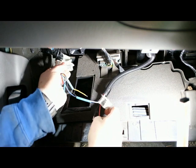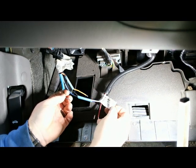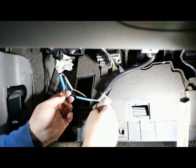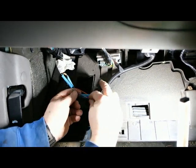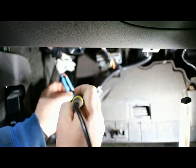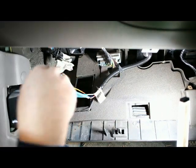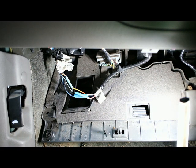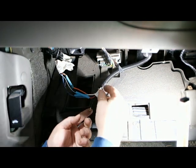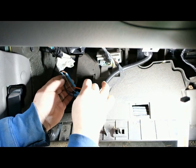And then we've got light blue is our turn signal, or is our brake light signal, and that will be red on this one. And again, that wire is the one that gives us the ability, when we manually activate the brake controller, it'll turn our trailer brake lights on. And then last, just to verify everything's right, so the black on this side is our battery power, and the orange on this side is battery. So we're good. We'll have everything correct.